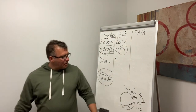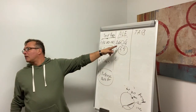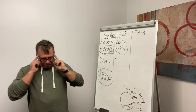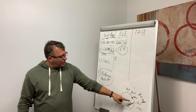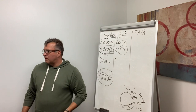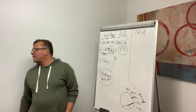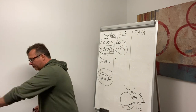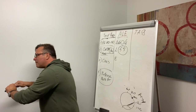Because they were watching the air gauges. When you're doing the low air warning device test or applied brake test, you're paying all attention to the air gauge, onto the cluster. Here you count how many PSI you lost, and here you're just looking for the buzzer light, right? But in case of the emergency brake system, you need to look at the parking brakes. All attention, look at them. Don't even look at the cluster. You need to see this very moment.